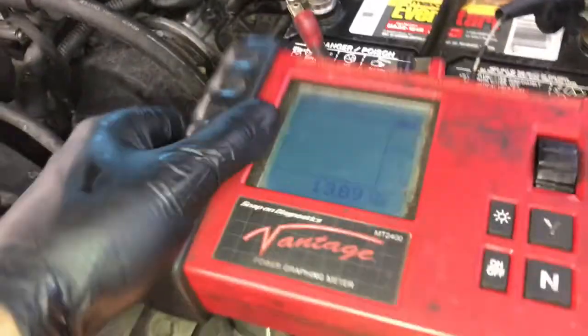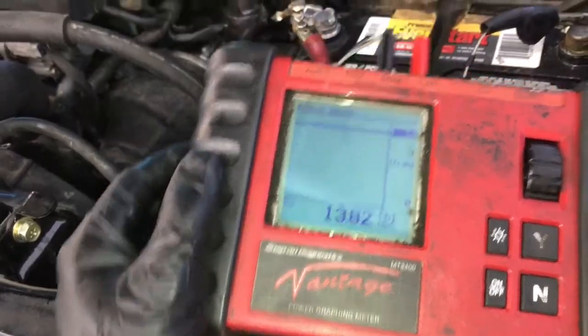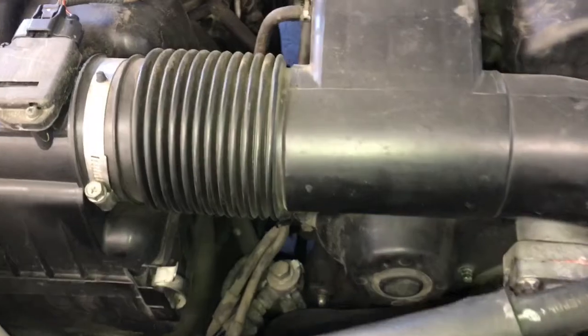Now you can put the lower skid plate shield back on and bolt it back up. Now you're ready to start the vehicle up. I recommend you put a voltmeter on it and double check that it's charging. And that'll complete the job of replacing the alternator on a Toyota Sequoia.